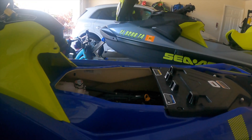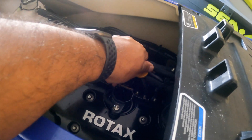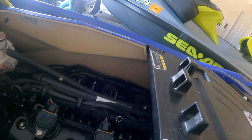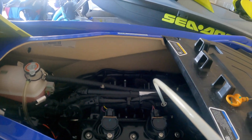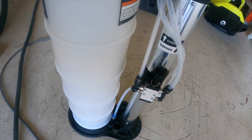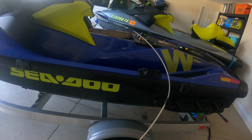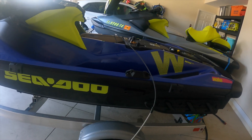So we're going to fire this thing up. Now that we've got the oil slightly warmed up to temperature, you're going to want to pull the dipstick out. It's probably a good time to check for any contamination and check your levels, just to make sure everything is all good. Now that you have the tube going into the dipstick hole, next step is obviously to make sure you're fully attached. We want to make sure that we are on evacuating mode, and we'll give this a couple pumps. Looks like we finally have some oil coming through here.